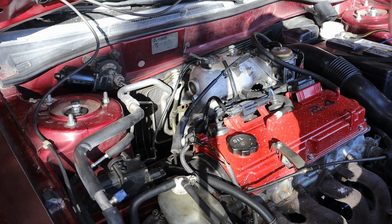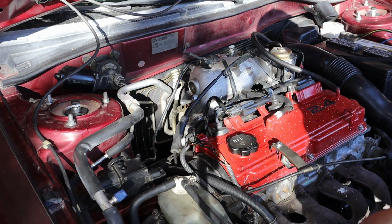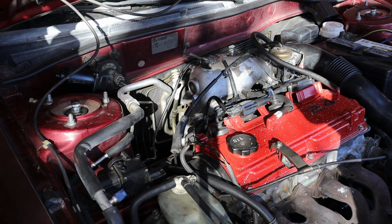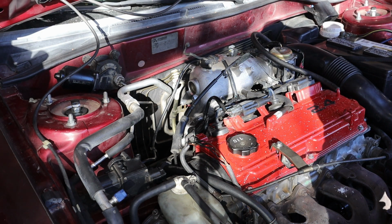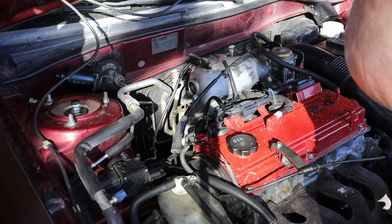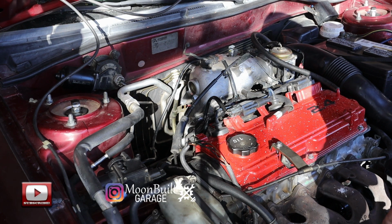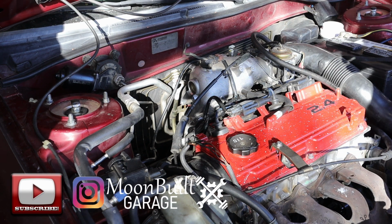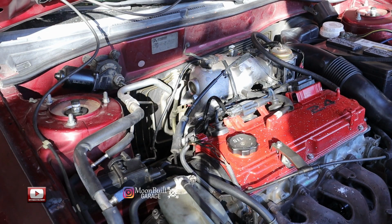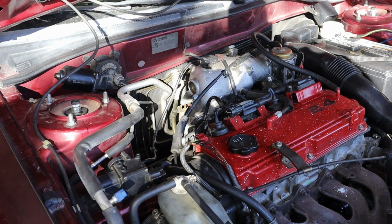So what we'll have to do maybe is get a can of coolant for it. Yeah. We'll look into it. I know you got to go. But yeah, this may just have to be cut and spliced into this wire. This wire goes to the clutch. So I just think either that connection is junk or it's low on refrigerant. Would I have to replace the AC compressor or something? No, not necessarily. We can try filling it first, see what happens.